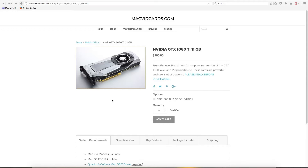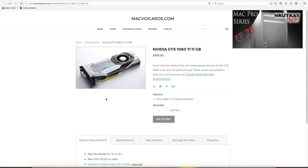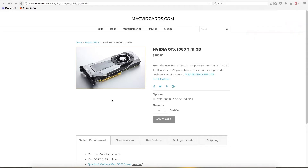With the Mac vid card, since it's still got the EFI flash on it, you can go into single user mode to enable EFI graphics mode, and then you can go in, update the driver, and then disable EFI graphics mode to get back into your original driver that you just installed. So that's the only major advantage of having the card. If you are interested in how that works, in Episode 28 I explained to you how to go into EFI graphics mode — it's quite simple, and as long as you follow that video, it's very easy to understand.